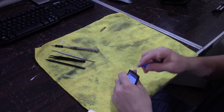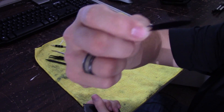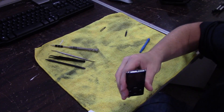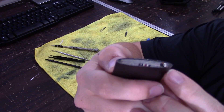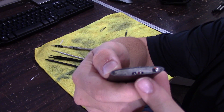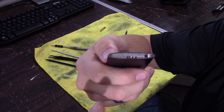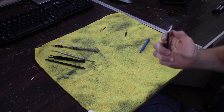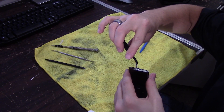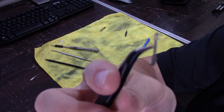Same for the top, and that piece comes off. These tops are just held on by a little bit of adhesive. Do be careful when you take that off — there is a little metal piece in there that controls the switch for the locking. Your tweezers can come in handy here. That's the piece right there.